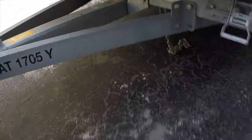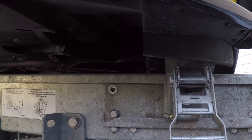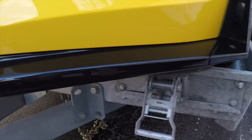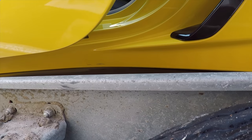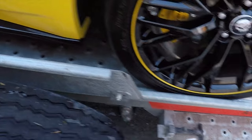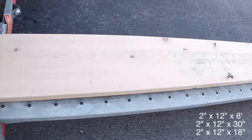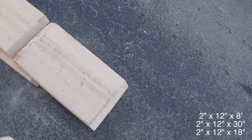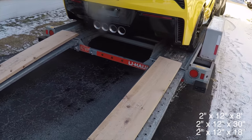You can see I've got the car loaded up. There was just that one incident — I was using the GoPro as a guidance system. Minor incident with that ratchet strap being down; the rubber pieces hanging down are very flexible, no damage done. There's about one inch on each side for clearance, door opens up fine. I used some 2x12 pieces — there's an 8-foot section, an 18-inch section, and a 30-inch section on the bottom to give it a better angle to get up on there.